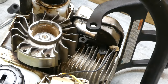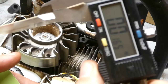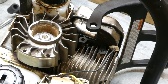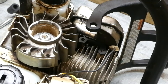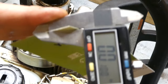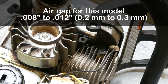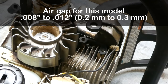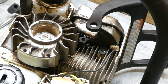I'm going to put that back on because it will help us keep alignment. We're going to find us a card. Some people say to use a business card — however, here's a business card, it's 16.5 thousandths, almost 17 thousandths. Most business cards are going to be in the 10 to 12 thousandths of an inch range, but there are cards out there that aren't, so always a good idea to check whatever you're using. I'm just going to use this piece of spam mail that I got in the mailbox — it is exactly 10 thousandths. For your air gap, you want between 8 and 12 thousandths; that's the recommendation by the manufacturer, so I go to the middle of that, 10 thousandths.